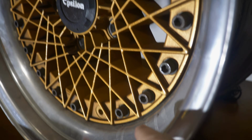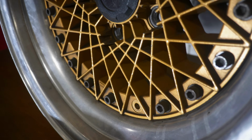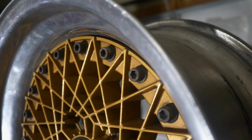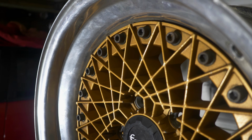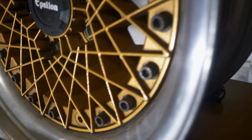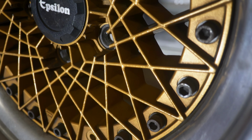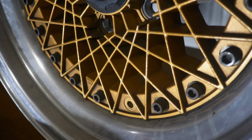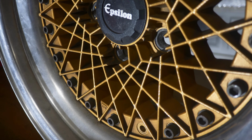It's kind of expensive because these are 3/8 bolts or 10mm or M10 bolts. Most bolts on wheels are like M6 or M8, but older wheels like these, when it comes to not being like 30 or 40 bolts in a wheel, like some BBS wheels, these were only 20 bolts on each wheel. So it kind of saved you there because there's only 80 bolts altogether. But the way they have these set up is you got your M10 bolt, which is an Allen head, which you can do like ARP bolts, which I'll throw a picture up. But I really do like the way these look, honestly. They're kind of different than all the other wheels out there, like BBSs and stuff. Plus I kind of think it makes it look a little bit more aggressive.